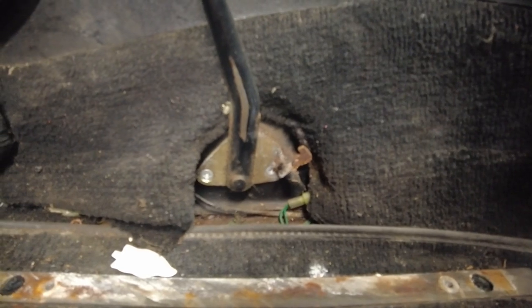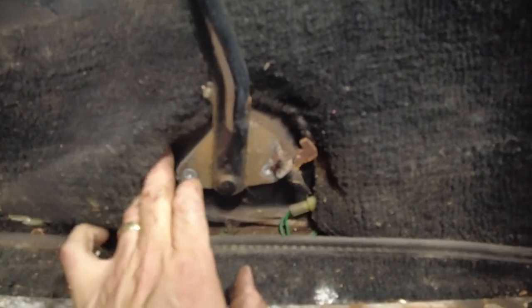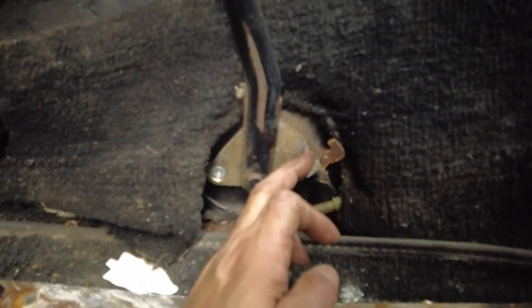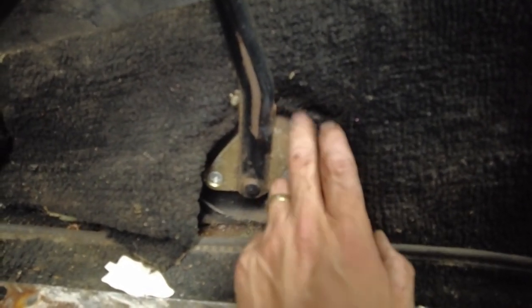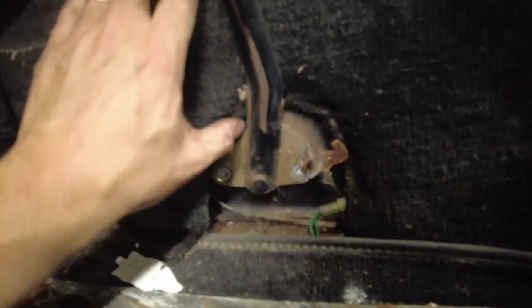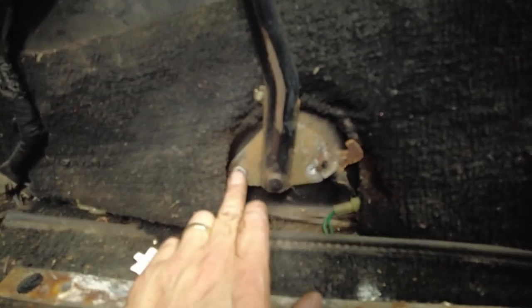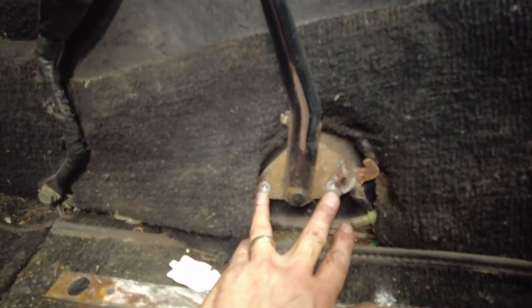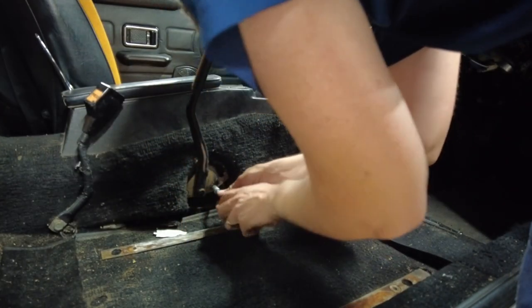Taking the seat out - there's only four bolts in this car and they actually walked out, no fight at all. Happy days, this car is just a delight to work on. So here's the offending article - there's our little brake light switch, that's the end stop, and this is the quadrant with the teeth for the pawl to work against. What I think has happened is the carpet is snagged on it, so I'm going to take those two screws out and have a look. The largest Pozidrive bit I have - and that was loose.